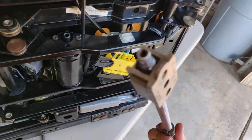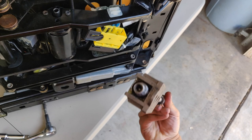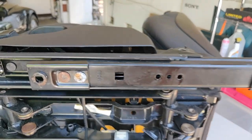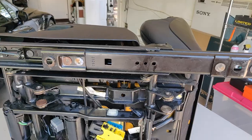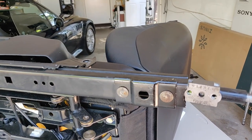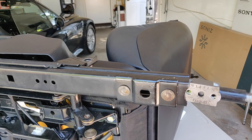To install the rod back into the rail, note that the end of the rod is a square. The end of the rod connected to the motor is also a square — these will connect to each other. So now you can begin sliding in the rod into the power seating rails. Note that you want the three holes facing towards you.